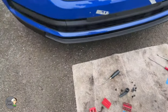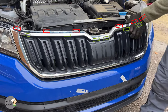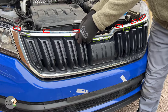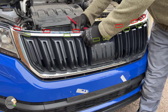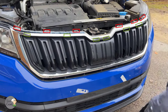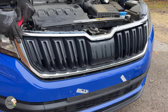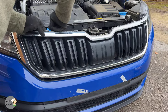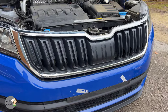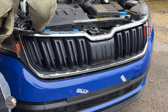Now we've got access to the chrome grille on the top side. You can see the tabs there that we're going to be working on. I've got several different pry tools. The green boxes I've indicated are the tabs on the inside edge of the chrome grille - I'm moving them with a screwdriver and also working on the top edge with a pry tool. What I found was they were trying to spring back into position because the green ones were still attached. What I ended up doing was putting mobile phone repair or guitar picks under the tabs to keep them lifted while I worked on the green ones.